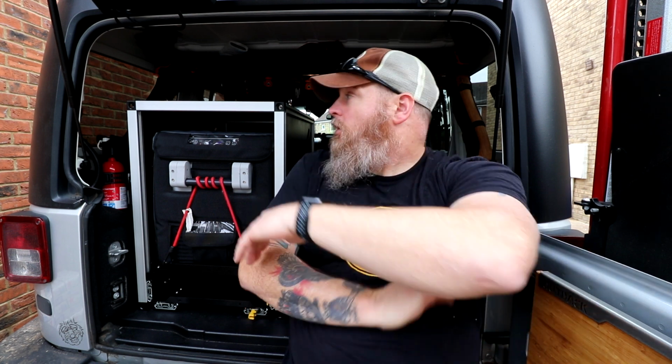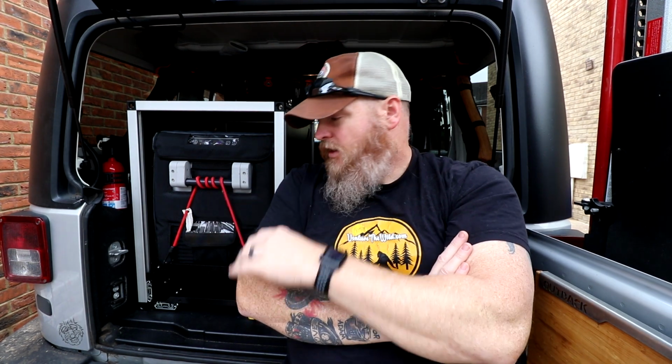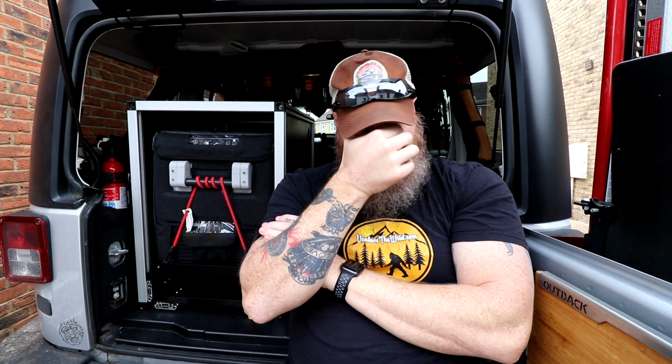Now if you get a regular leisure battery, you don't want one that's massive or something. So I'm looking at getting an Optima, another gold top like I have under the hood, or possibly a different style of sealed AGM battery that can just go back here somewhere. Christian from Axe Amos on Instagram has just done this for me, so I've got a slide system. I'll do another video on that for the fridge and the cooker, and he's also building cubbies for the side, so it will end up hiding the battery inside that cubby somewhere.